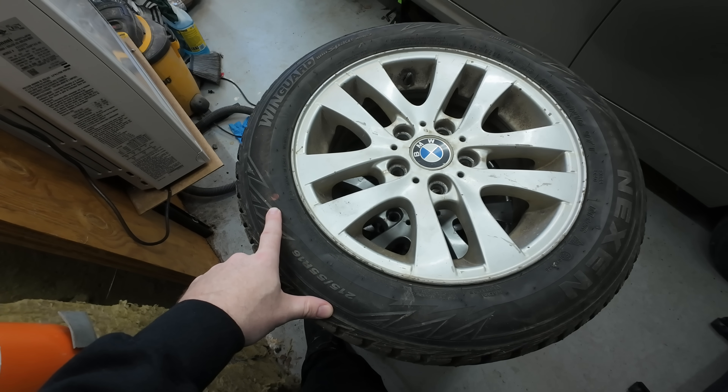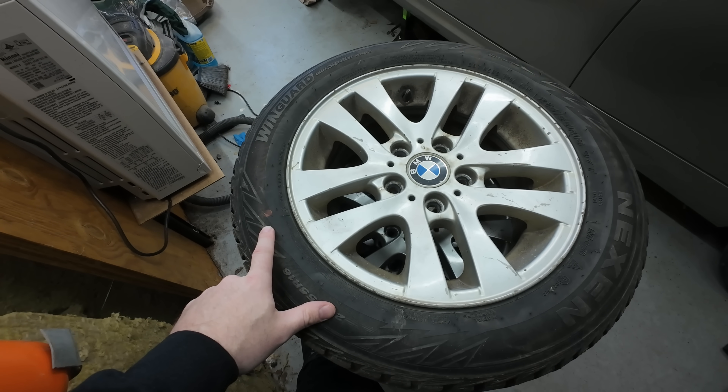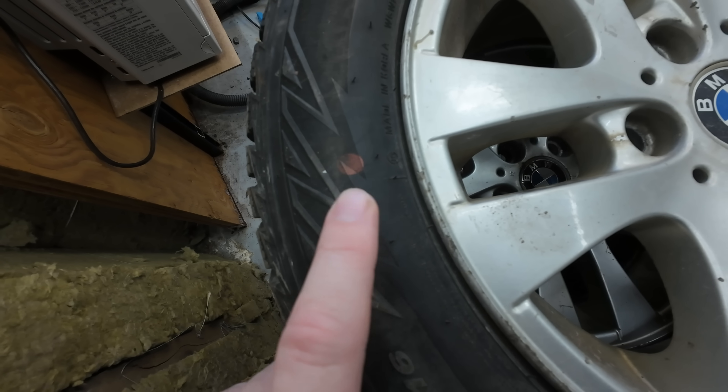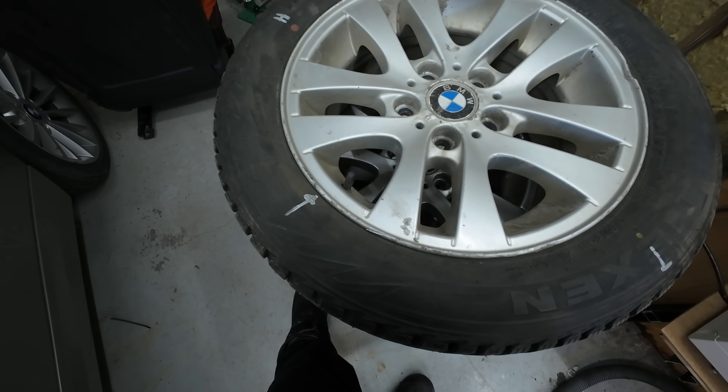What if I told you that when it comes to mounting tires on rims, every technician does something but they don't know why — and they're making a crucial mistake? It relies on these yellow and red dots you see on the side of the tire. To the general viewer, it has been taught for ages that when mounting and balancing tires you line these dots up to the valve stem. That is 50% correct. Most technicians don't actually understand what it means.